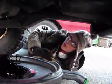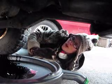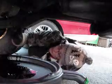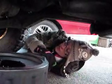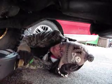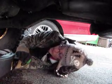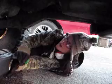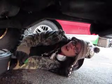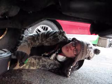So then move your oil pan to underneath wherever your oil filter is. Depending on your car, it's going to be different. Mine is right up here, so I'm just going to move it over here to right underneath that filter. Usually you're going to get to the filter from the bottom most times, but the way my Jeep is made, I got to it through the top.